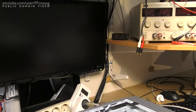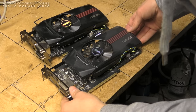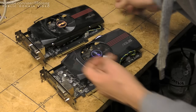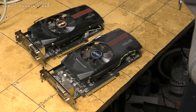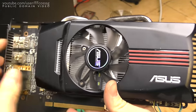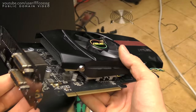We've got a picture. The rusty old card is actually working, so that's what we'll go with. These coolers are identical between the 7770 and the 6850, and the 7770's cooler is in much better shape — so I'm just going to swap it over rather than bothering to clean the 6850's cooler up, since the fan on it looks like crap. Rusty piece of crap card with an almost brand new cooler. This thing has so few hours on it because I always ran an aftermarket cooler on the 7770.